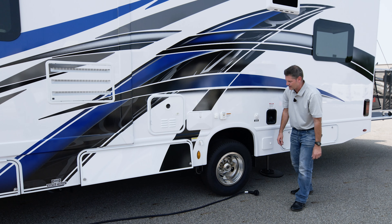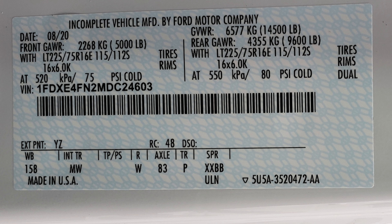I do want to talk about tires, because they are very important - they have a key role in towing and need to be properly inflated. You'll get a better ride and better fuel mileage. We have a valve stem extender so you can read air pressure on the inside tire. These are going to be a lot higher pressure than your car tires. Tire pressures are located inside on a label. Make sure you have your tires properly inflated before every single trip - best done in the morning before driving, when they're cool.